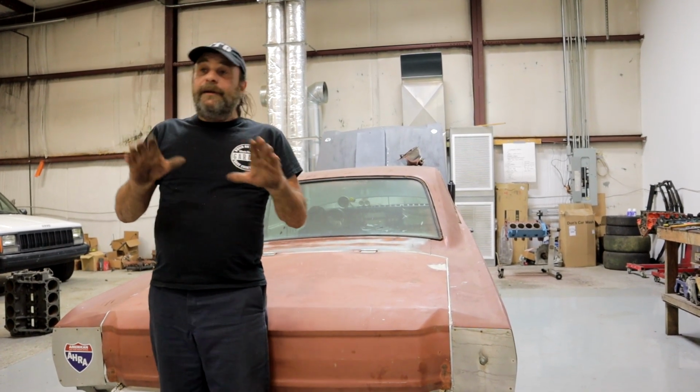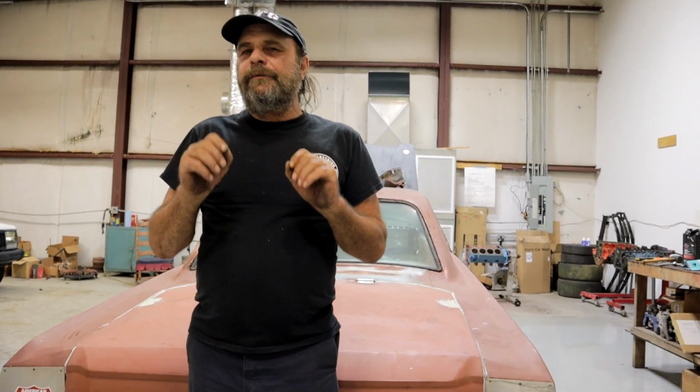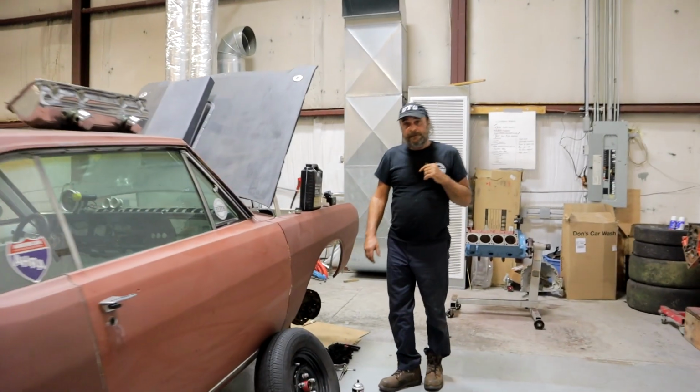What happened was the car, as I let off, just went crazy out like that. So, all right. And it didn't feel quite right. It was like weird getting the burnout started. So what happened was, this wheel cylinder right here is seized.